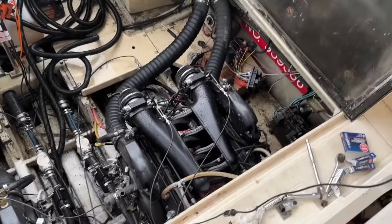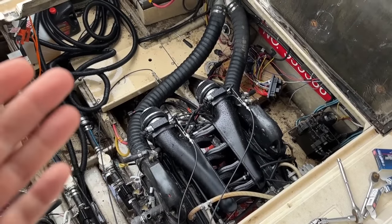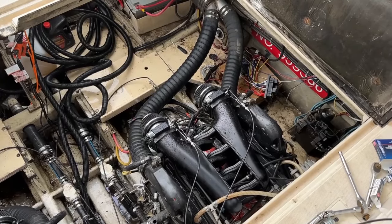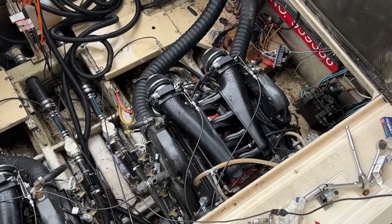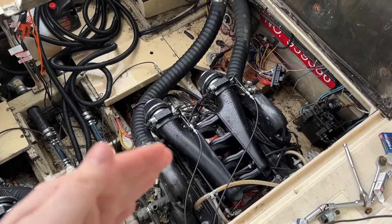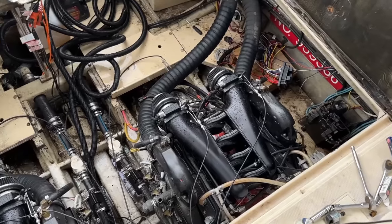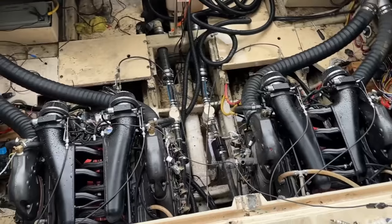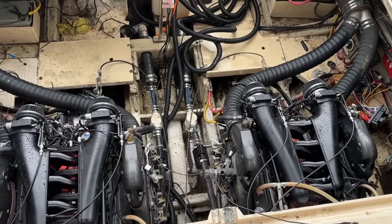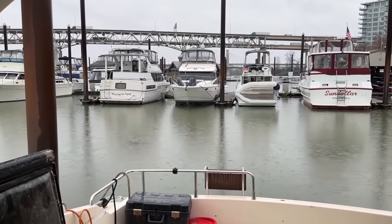Happy to say it was the IAC — it was stuck in a closed position, which was really bad, but no damage done to the engine since we weren't running them at full throttle. That was causing us to run too rich and we've got it solved. Game plan now is to get two working O2 sensors, one in each engine, and go boating — go enjoy this wonderful Oregon weather.